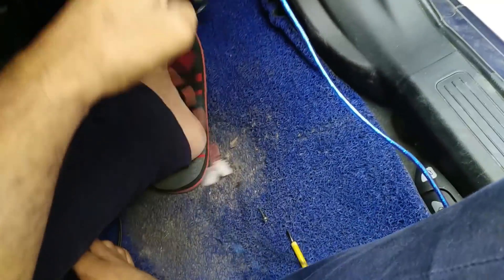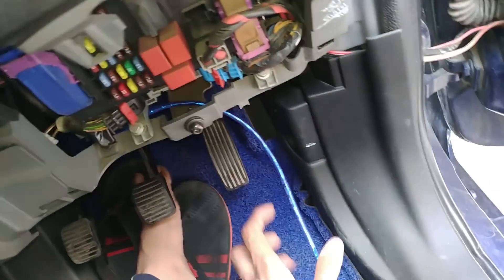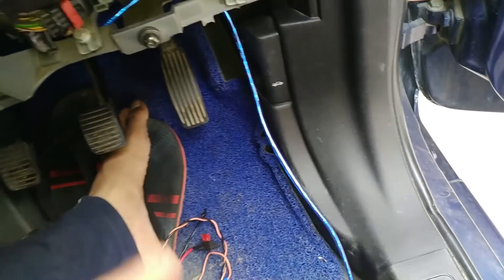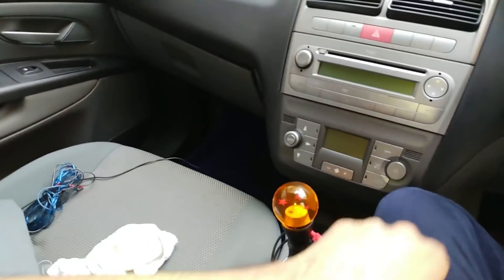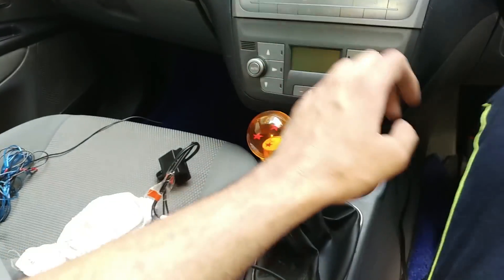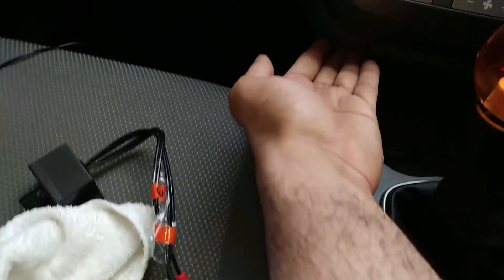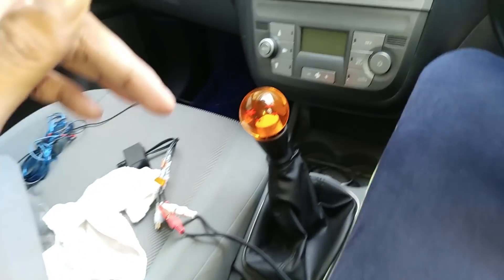I'm going to install the remote wire and the joint connections. I have removed the old wire and installed a new one here. I'll tuck it and route it through here — the bass knob wire is connected on the input side, but the output side is not yet. I'm thinking of mounting the bass knob with double-sided tape so the wire length stays short and neat, with no problem and a clean look underneath.